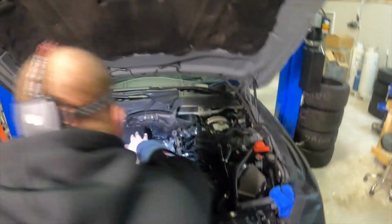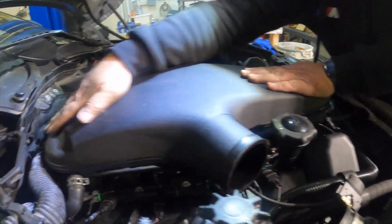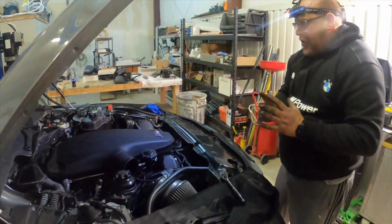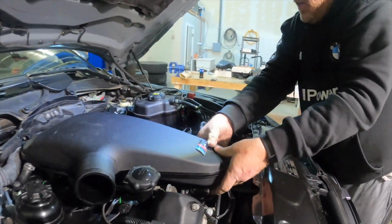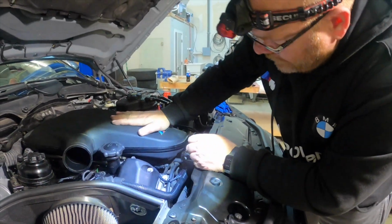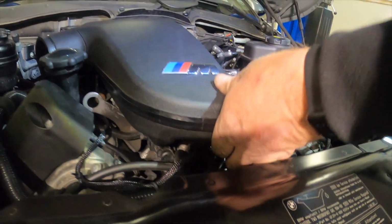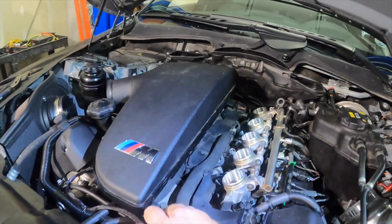As you can see, the plenum is seated, and it will have a rock on it until it's completely tightened down. But everywhere we look, we've got our boot completely around the valve bodies, and then we have connected this one on the left side plenum, which we will then sit the second plenum in, make the rear connections, get that mounted and pushed up.